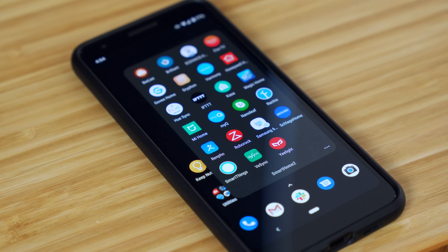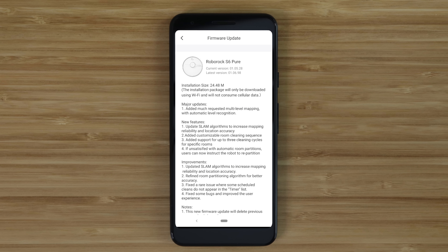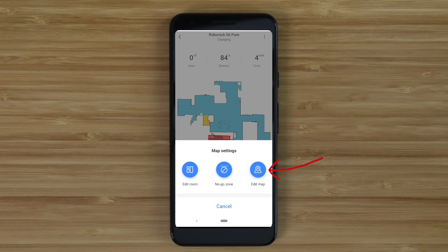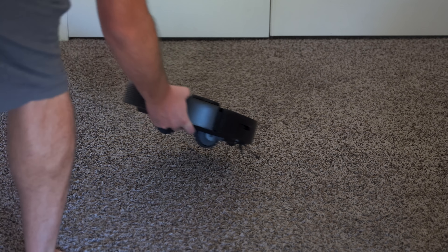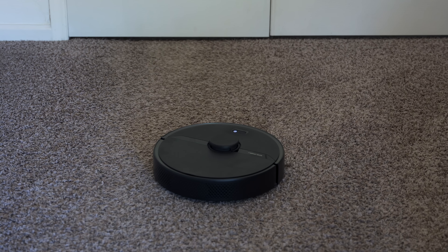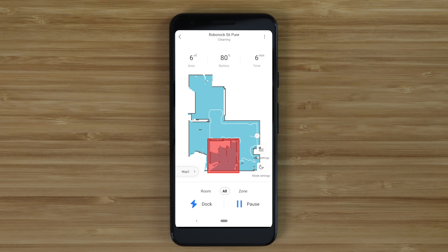You have two options: the Mi Home app or the Roborock app — but don't use the Mi Home app, use the Roborock app. The firmware update for multi-level mapping only showed up in the Roborock app. I updated the firmware and was really excited to try it out, but I couldn't figure out where to do it. Roborock makes it seem like it just automatically creates a new level in the map, but it doesn't — you first have to activate it in the app. It's in the map settings on the main page under Edit Map, and on that screen you can enable multi-floor mapping. I only have a one-story house, so to test this I moved the robot vacuum to a bedroom it hadn't mapped yet to simulate another level. The app says to move the dock to the new level as well, but I created the new map without moving the dock just to see if it would work — and it worked fine. I created no-go zones on the second map and everything worked as expected.